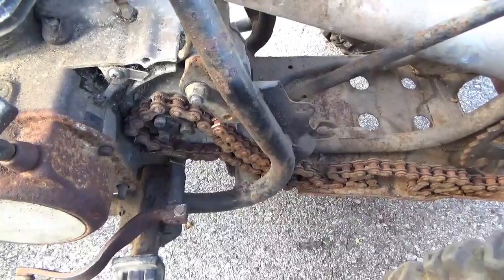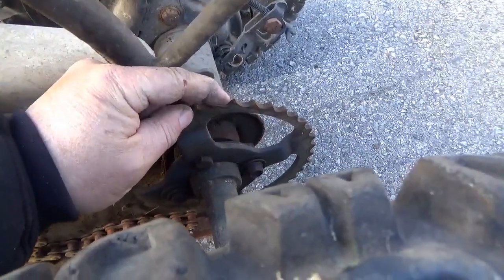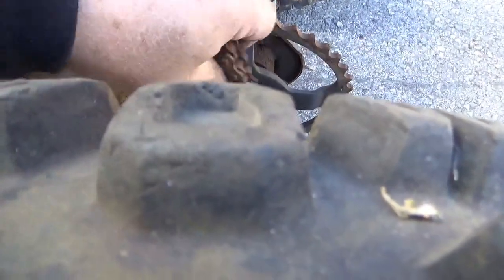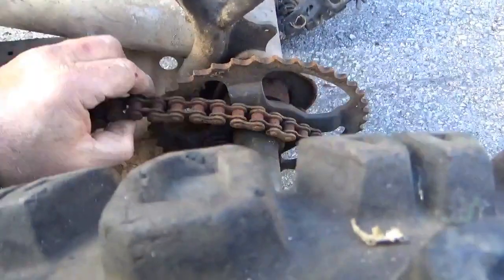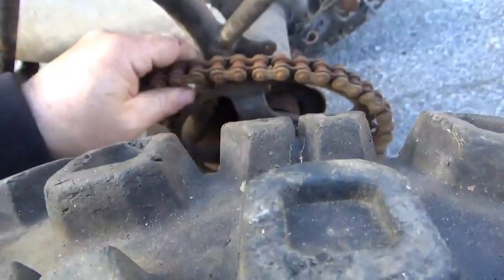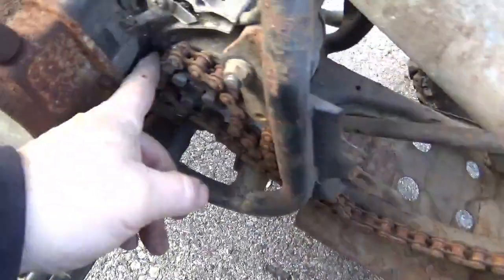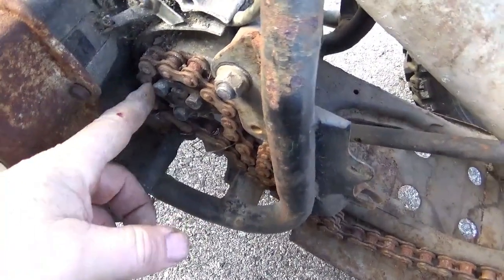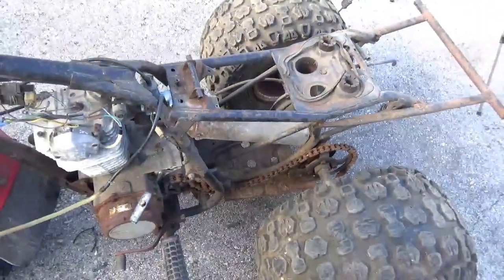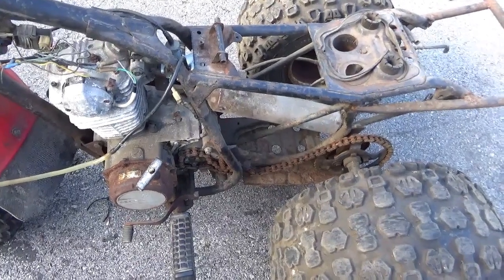I dug around the hoard and found a chain, but the sprocket is just so worn — you put the chain on and it looks like it's not only going to slip, it could throw it. The last thing I want to do is destroy this nice running engine. On the sprocket it actually bags up in the front, which could punch through the case. So I ordered sprockets and a chain for this thing. I've got about $300 in it and the parts were about $75, so I'll have $375 in here but I'll have a nice chain and sprockets.